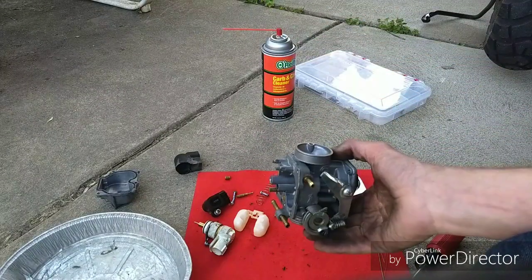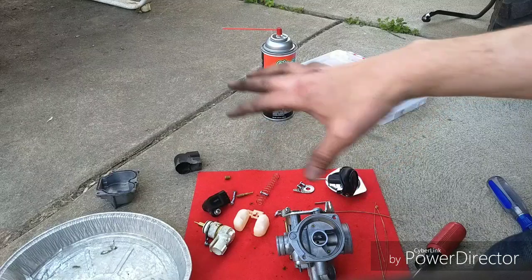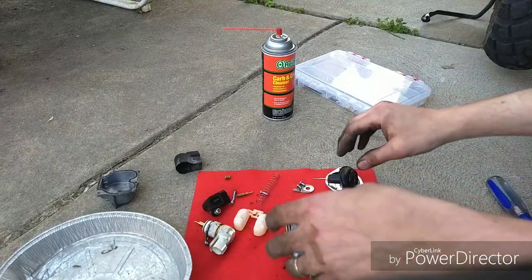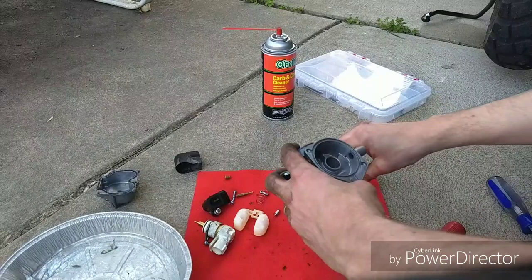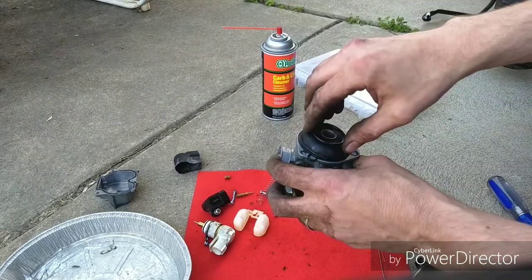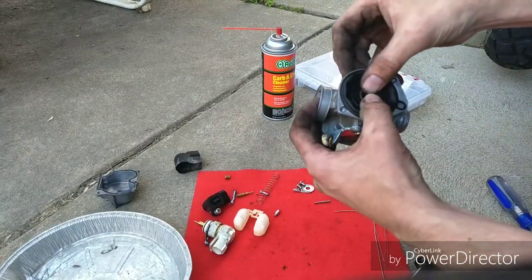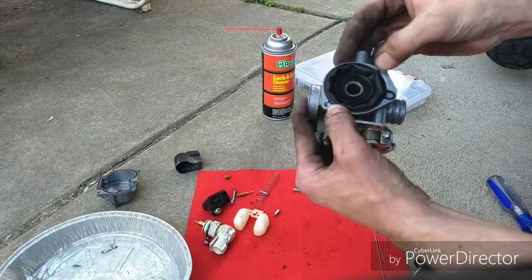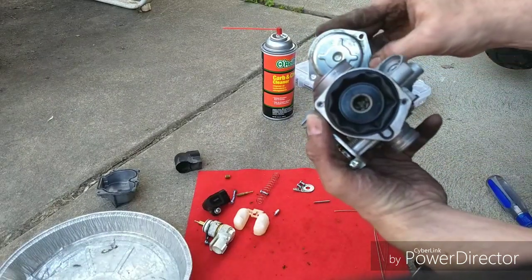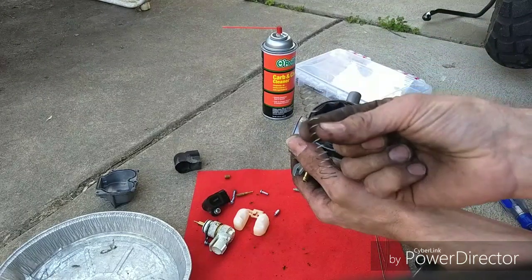The carb is all clean. I took all the rubber parts off — everything that could be corroded by the carb cleaner — cleaned it up. I'm going to reassemble it to the point where you'd be if you were just rejetting for an intake. Let's do the diaphragm first. Remember to be very very careful with that needle — do not want to bend that. Turn it around and get it in there, make sure it's seated properly. There's one side that has a screw hole and a corner — set that down, but don't forget the spring.